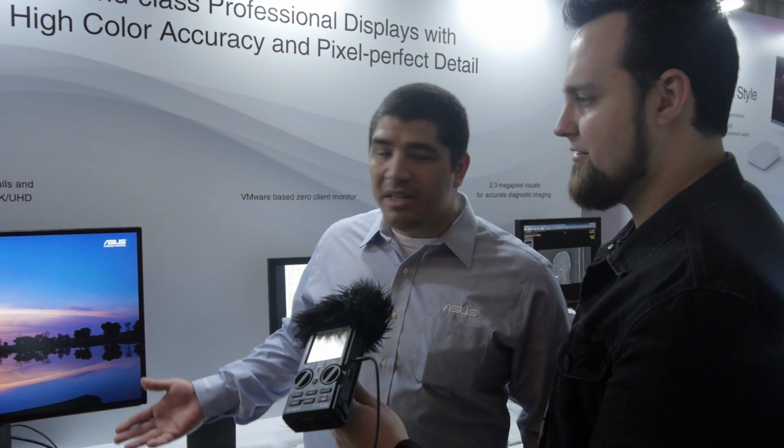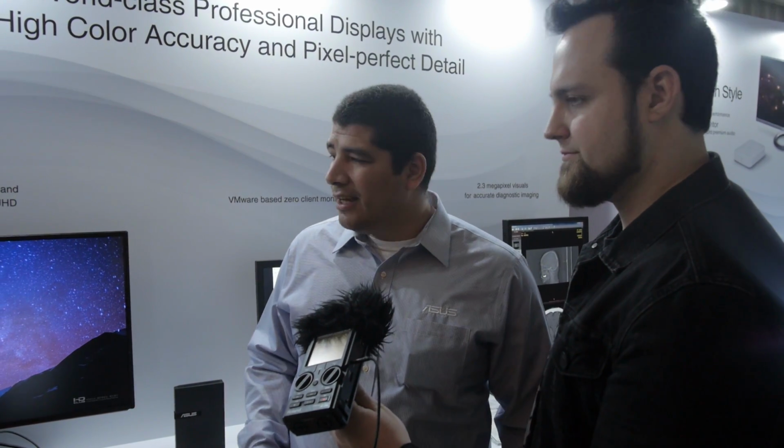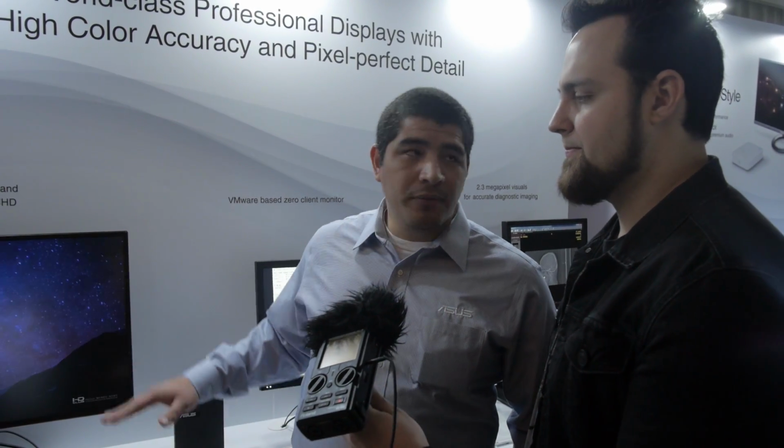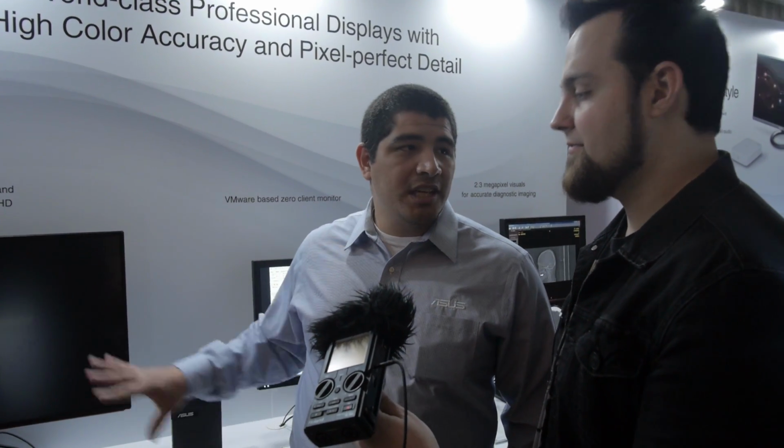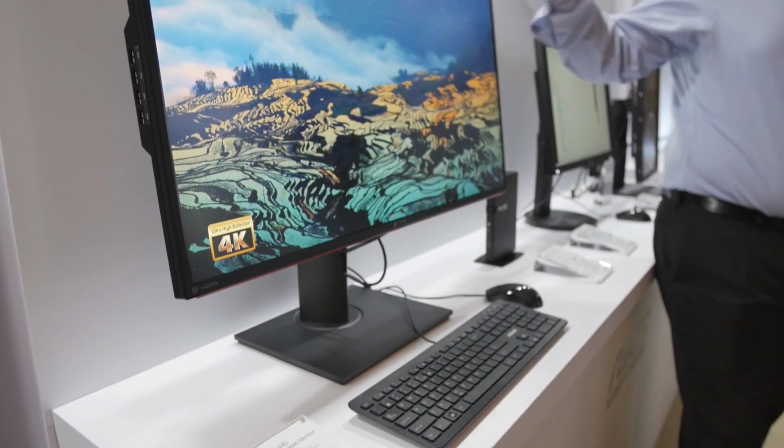Of course, it's 4K based resolution. It's full Rec. 709 color space rated, 100% sRGB. We've got pretty much all the connectivity you want on there. Mini DP, DP, HDMI. You got MHL 3.0, HDMI is 2.0 as well. 4 USB 3 ports. You got the full tilt, pivot, height, rotate adjustment parameters on there. It's absolutely just an amazing looking panel, factory calibrated out of the box.